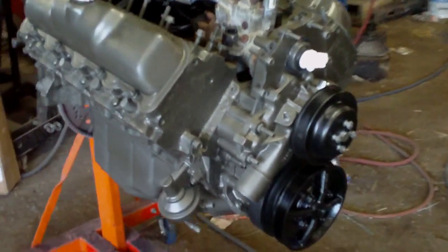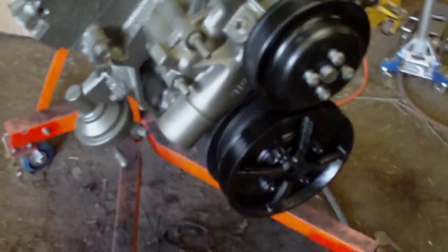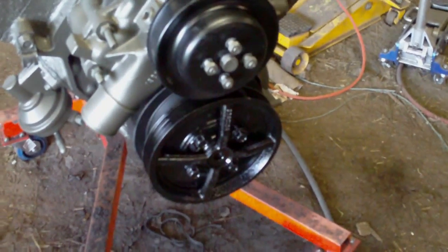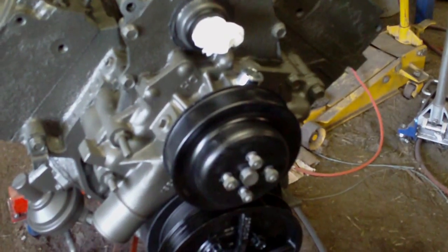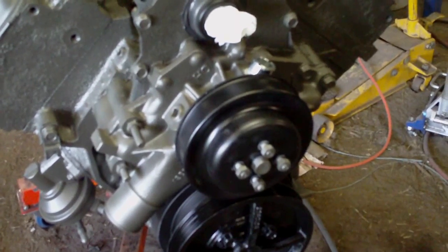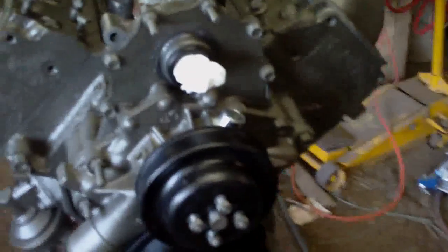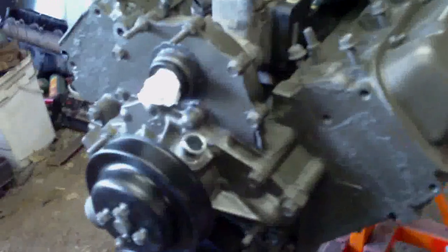There's the engine. The crank pulley, or harmonic balancer pulley, is on permanently. The water pump pulley is not permanently on — it won't really be permanently on until I put the fan that's in that box on. There's no point in putting that on until I'm nearly ready to put it in either the test unit or directly into the frame. None of it is really ready to go there yet.